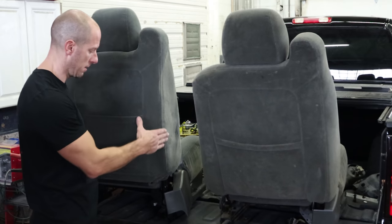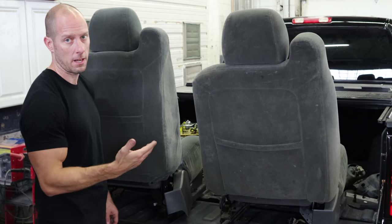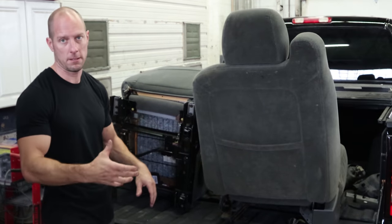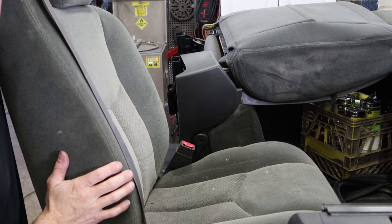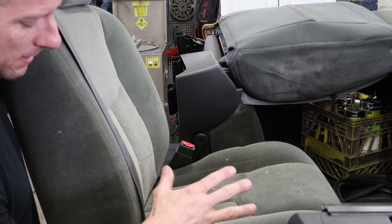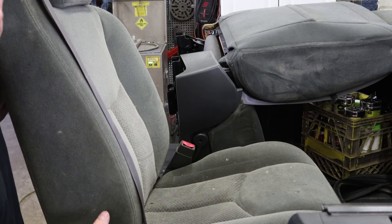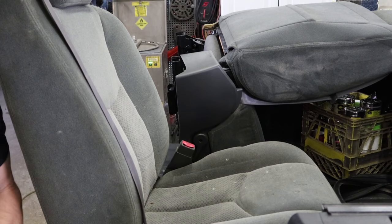So our seat here is a little squished from the B-pillar coming in — it's got cardboard, padding, and even a little bit of metal in there, it's smashed in. Our 06 seats, which would have been a worthy replacement, are different; there's a bunch of sensors on the bottom for the passenger presence system that tells if there's a passenger, where they are, and if their seatbelt is buckled. So rather than swapping it all over, we've got this ugly seat — cigarette burns, really dirty. We're going to use just what we need: the inner cardboard, padding, and metal. For the seat back, we'll take our seat cover and put it on this one, leave the bottom all alone so our sensors are all right. We'll have one complete seat and can throw the other in the pile.